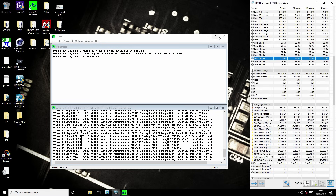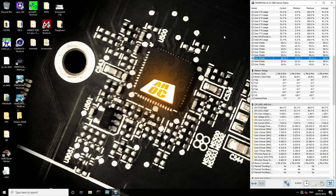That's really all there is to doing a Precision Boost Overdrive overclock on ASUS motherboards. With the limits of 300, 230, 230 for my 3700X and my 3950X, those limits work the best and give the most consistent performance uplifts. I have seen one combination of settings that scores better in Cinebench by about one percentage point but loses about 1% everywhere else — so just use 230. Go back into the BIOS: go into PBO, set those limits, enable your XMP, and make sure you're at 3600 MHz if you don't want to mess around with memory stability testing.